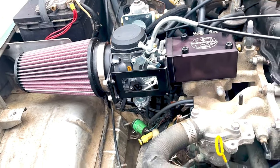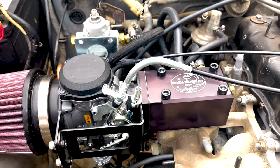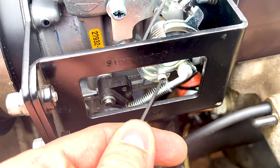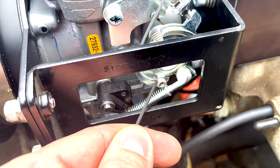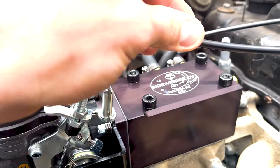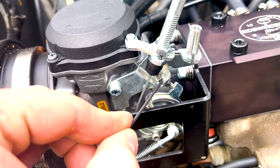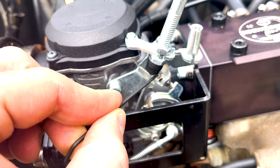If you need to adjust the throttle, here's your throttle cable. The throttle cable comes in the front, which is nice because on the old Suzuki it wrapped all the way around the back, but this one shoots straight down in there. That little piece right there is where you cut your old throttle cable and put this on the end of it and use that. As a tip — because I screwed mine up — I would have another one of these just in case, because the worst that can happen is you need a brand new throttle cable. If you need to adjust this, there are two screws that are 7mm. When you back those two off, it allows that set screw bolt in the middle to run freely in between.